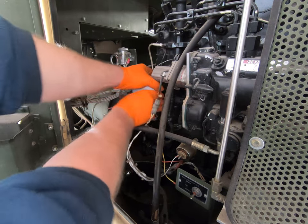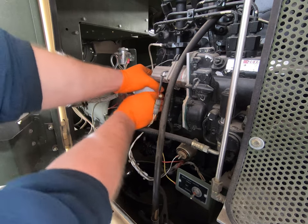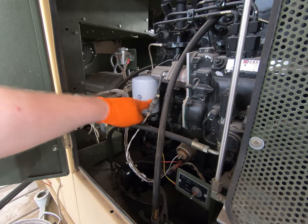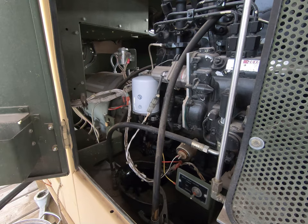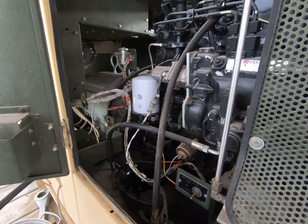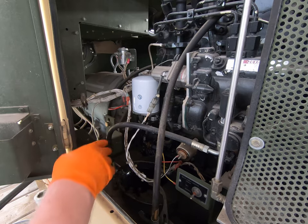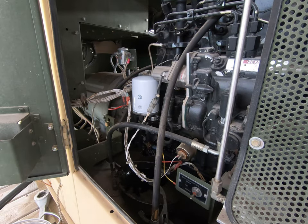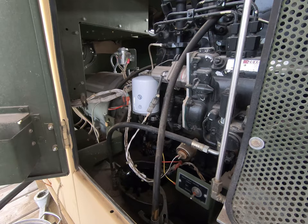I can do most of that just with two hands. We started with the filter at a certain point and now it looks like we've made three-quarters of a turn after contact with the base — that should be good. I've had pretty good luck doing oil filters that way rather than torquing them on with a torque wrench. Now I'll clean up the spilled oil, shut off the drain, and refill with oil.